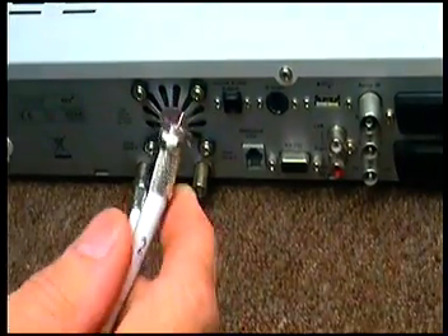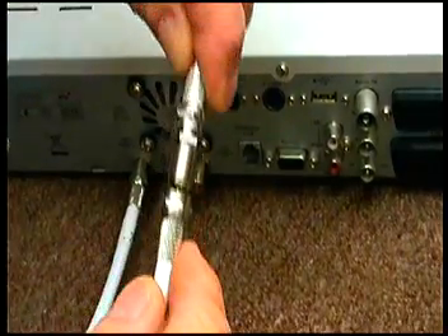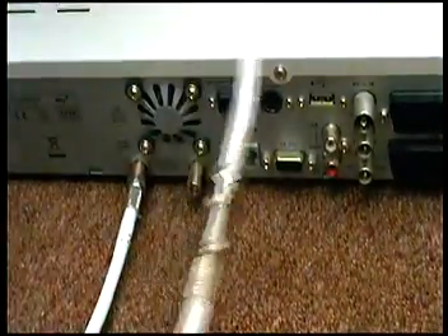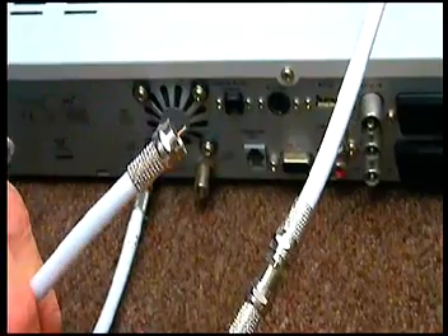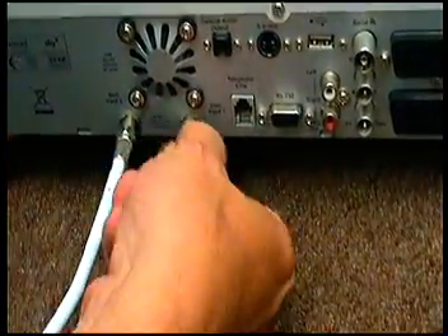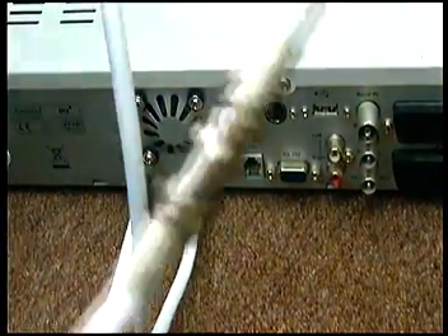To extend that, I get the extension cable — as I said, we have two here. This just fits in there like it would if it was screwing onto the back of the Sky box. Turn it clockwise this time, nice and tight — that's our connection. Now the other end of the cable with the female end on it screws back onto the Sky box — turn it clockwise — and there we are, this is our extension now on this cable.